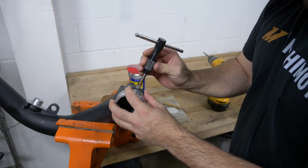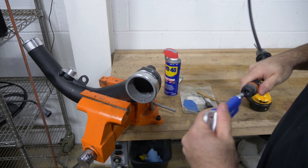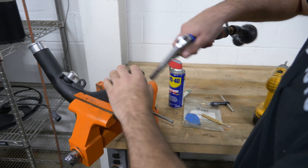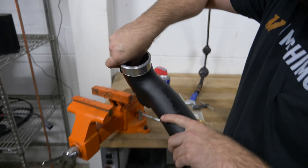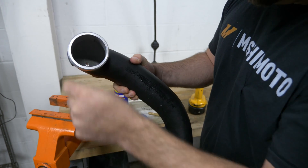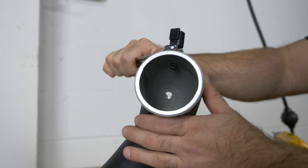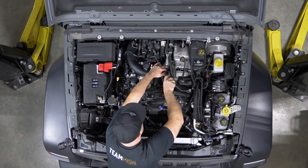Back this all the way out. A couple of important things — I'm going to wear eye protection. You want to blow your flutes out for next time. You want to make sure you clean this thoroughly and deburr any hanging threads or pieces of cast aluminum. You don't want this to get in your engine. Adding accessories to this intercooler pipe is that easy. Just reinstall the pipe and you're ready to hit the trails. Take care.